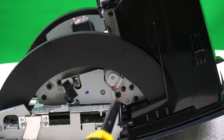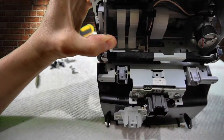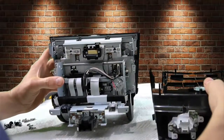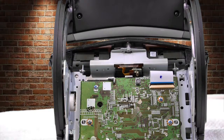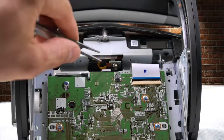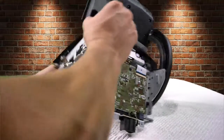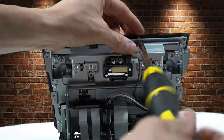Now you just want to turn the unit on its side and loosen these screws on each side. Don't unscrew them all the way. Next up, remove these 5 screws right here. Now that you have those screws off, you have these 2 tabs that are holding this other protective piece on. Once you get those tabs down, you're just going to pull that right off just like that. Next up is removing this screen ribbon that I'm pointing at right here. The way you do this is you have to move this little tab upwards and then take some tweezers like this and delicately pull the ribbon straight out of the connector, just like that, and then remove this screw right there. The reason you didn't unscrew those other screws earlier all the way is so you can flip up the door, and the way you do that is just pull on it with a little might. It won't break it. Now you're just going to want to unscrew these 4 screws right here.